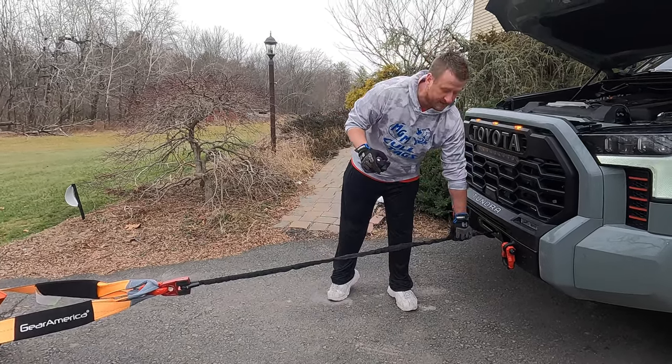So now with this last few feet of rope, we can simply just put our body weight on it. I'm using the D-ring attached to the flat link still, just so when we get up close to the fair lead you can use a tag on this — which I would actually do — but for this situation, this is perfectly fine, just to keep your hand away from that fair lead as we get closer. So with my body weight on it, we're just going to pull the last few feet in, take our D-ring off, position our flat link how we want it, and then just give it a little tap — making sure your fingers are not behind there. Get it positioned right in the middle, give it a little tap, and we're done. You don't want to winch that too hard in there, just snug to keep it in place.